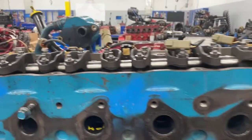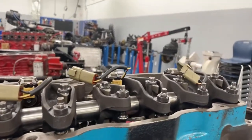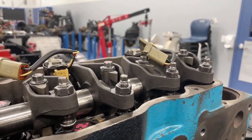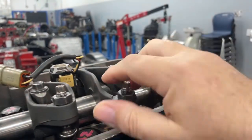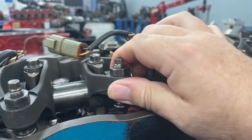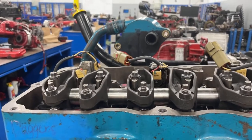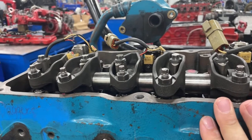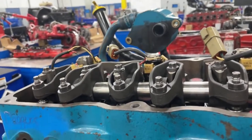This is important because it helps you identify engine position. During the compression and power strokes, the valves are closed, which means the rocker arms during those strokes are going to be loose like this one here. If we look along this engine and see a rocker arm that's really tight, that means the valve is open. The only time on an engine like this that both valves are open at the same time is top dead center of the exhaust stroke — that's what we mean by valve overlap.